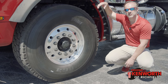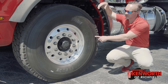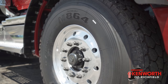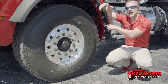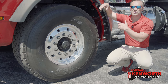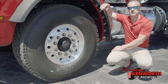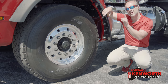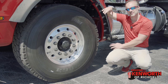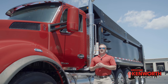With this being a six-axle dump truck, it only makes sense to have the wide base front tires on this. These are 425 Bridgestone M864s. Inside of that, we've got drum brakes. This uses a MFS-20 Meritor 20,000-pound front axle. We've got 22,000-pound leaf springs under it, so if you come out maybe a touch heavy on the front end, maybe someone won't notice. This truck is what I like to call Just Right Spec.